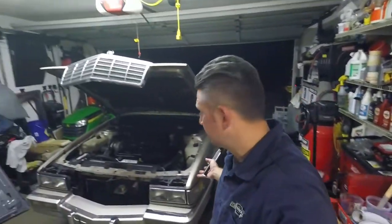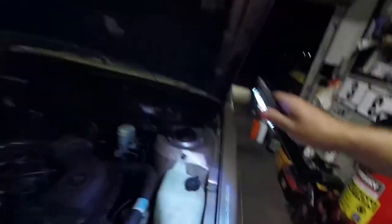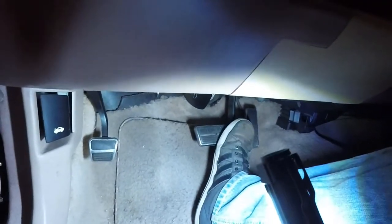Back on the ground. The master cylinder cap is back on. Now, this is very important, and I'm gonna tell you about this twice, because this is how important it is. So first thing we're gonna do is I'm gonna put this fuse back in and put the fuse box back together. Now, because I compressed the one caliper, you're gonna need to take up that space. So if you watch, when I pump the brake, it's gonna go right to the floor. See, there's no resistance, right?